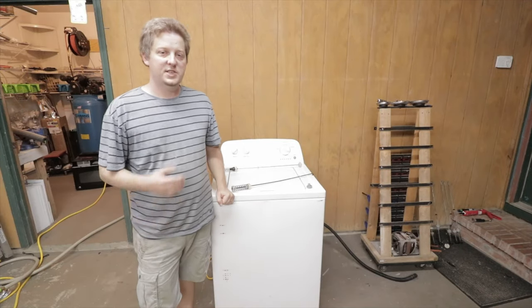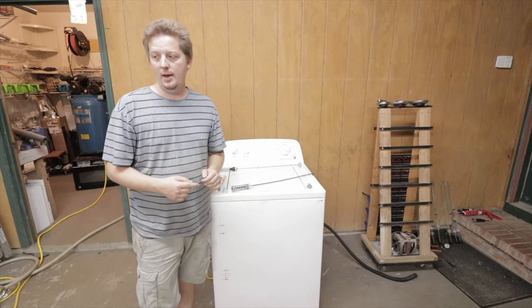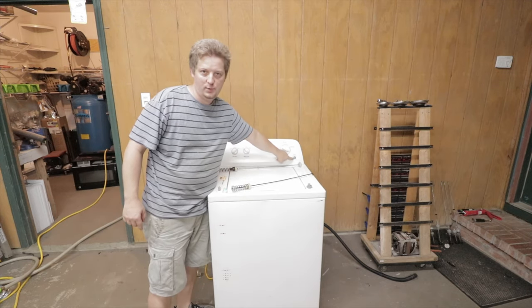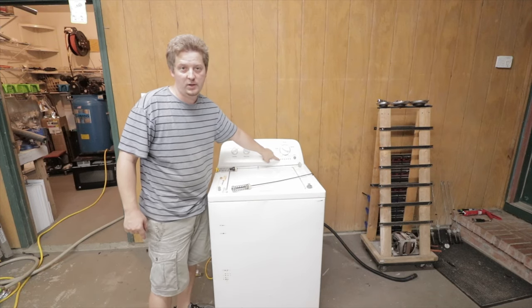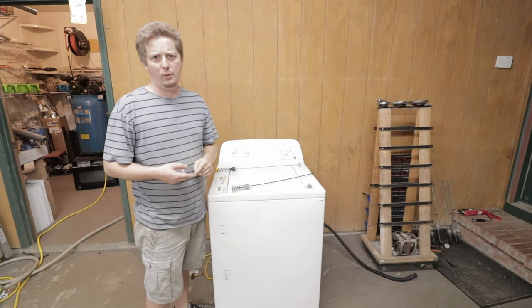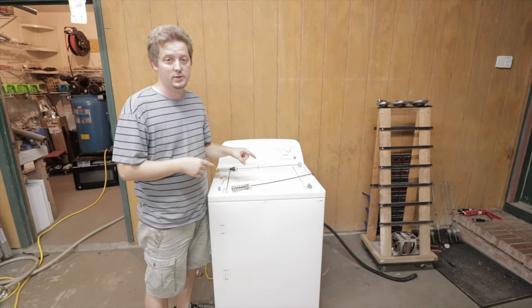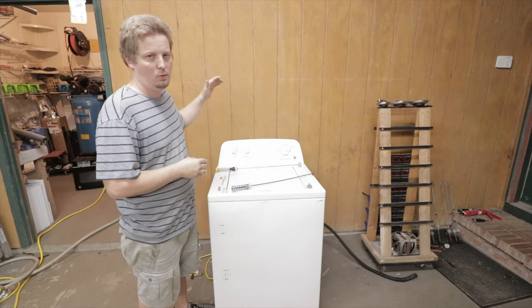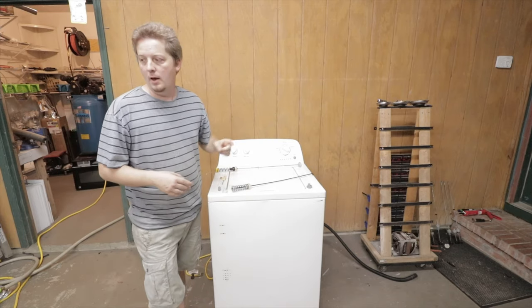Today we're going to talk about the suspension rods going out in machines — any repair guys know this is a huge problem happening a lot. Real quick on what kind of machines: if it has a little round button with a pause/play symbol and six little LED lights that come on, it's a really common problem. I've seen Samsungs and other higher-end brands with top loads held up with suspension rods that have the same issue. It's not just these types, but specifically anything Whirlpool makes — Roper, Whirlpool, Amana, any of their sub-brands — if they have that pause/play button, it's definitely a problem.